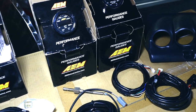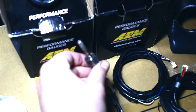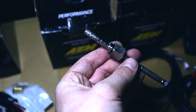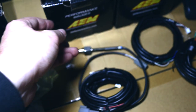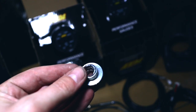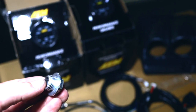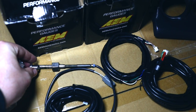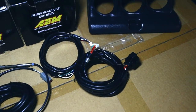You have a sensor like this — an exhaust temperature sensor — that will be connected to the gauge. What I did is I have these caps in the exhaust, and I made a hole in one of them like this. It's easier to install a plug in there, which I'm going to weld onto it, and then I can hook up my sensor and screw everything in.